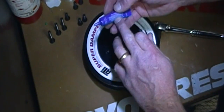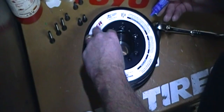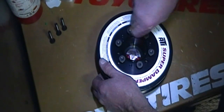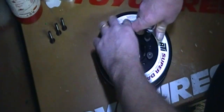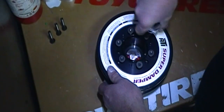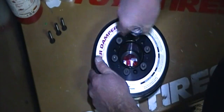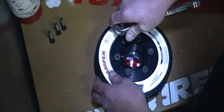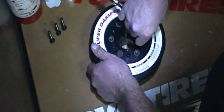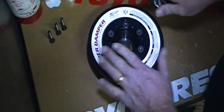This is the top flange — that's the one it's on. You're gonna need your blue Loctite again. Just because the container's blue, it's blue Loctite — it's the proper one. These come with Loctite on them, but that doesn't matter — you're gonna put a little shot of Loctite on them and stick them in. Then turn them down as much as you can finger tight. Once you get them all tightened down, you're gonna torque them down — going across, across, across until they're all evenly hand tight.